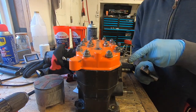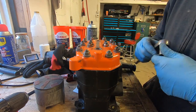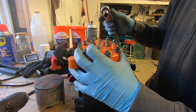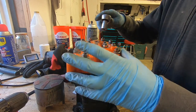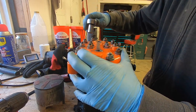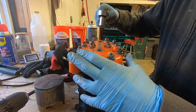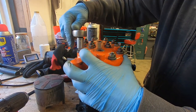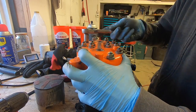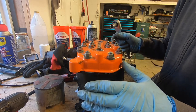I've checked the clearance between the cylinder and the head and got 34 thousandths. So now I'm going to hand tighten this, just snug it up, to make sure that I don't overcook anything. Then I'm going to go back and tighten it to 14 foot-pounds, then to 20 and then 22. I'm doing it in a lot of stages because I don't want to tighten the head unevenly and damage anything.